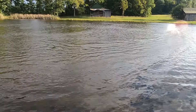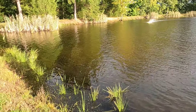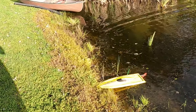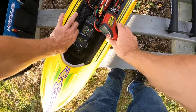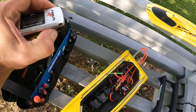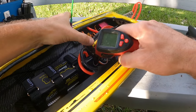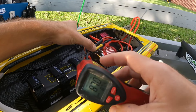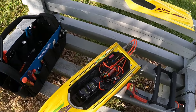I'm going to do a cool-down lap. Let's go ahead and take it over there and open it up. Let's see what we got — only 34. So now we've got some pretty good preliminary numbers for 1650 kV. Next motor I think we're going to do is a 2650, and we'll really be able to tell how much kV matters. 92, 99, 87 — not even stroking, man. But we do have water in the boat, so I really do need to tape it up. I just wanted to see if it was worth a damn for the hatch tape, but it doesn't look like it.